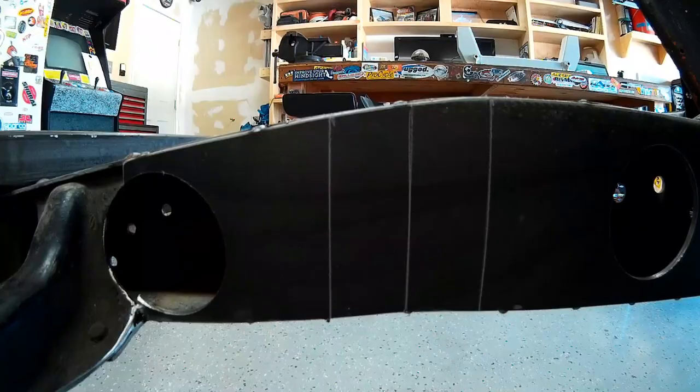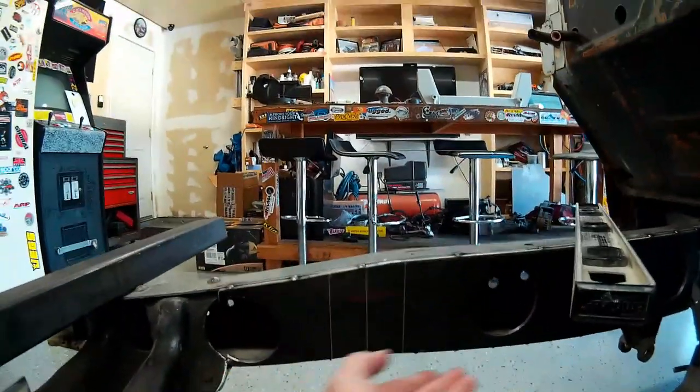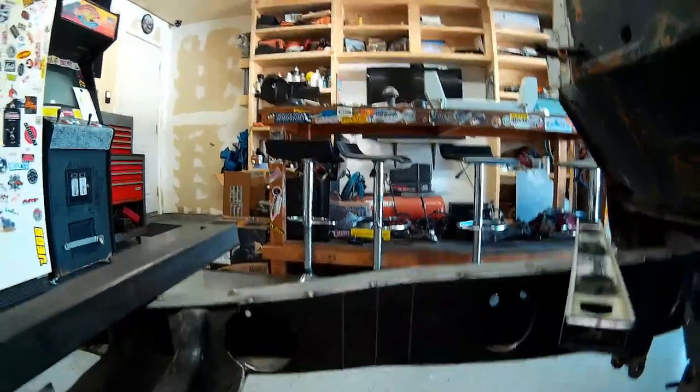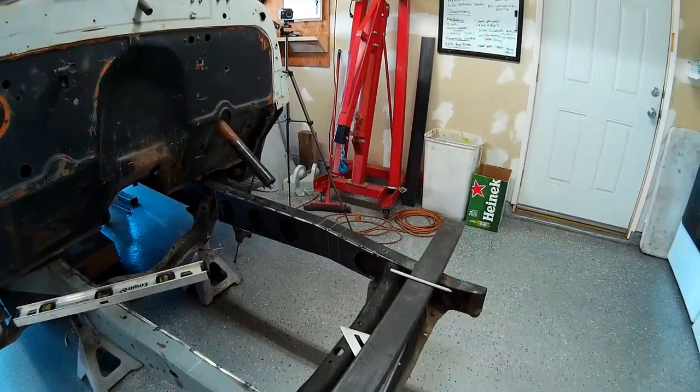There's really nothing that you can do to measure square. The top of the frame is level, but the bottom of the frame isn't, and this bend isn't horizontal or level to the horizon. So what we've got to do is use a level and drop some plumb lines, which is what I've got on there. And the next step is to transfer those horizontal and vertical dimensions onto our crossmember and trim it, because the crossmember is going to be at an angle to match the frame rail. So it makes it a little bit challenging.